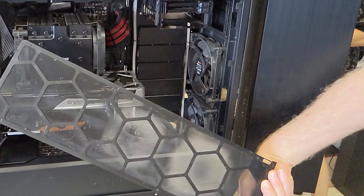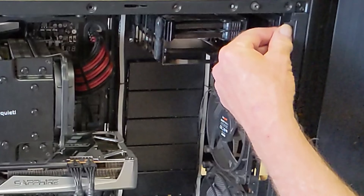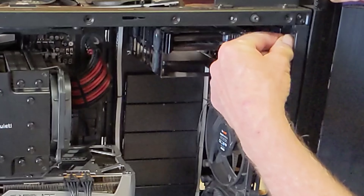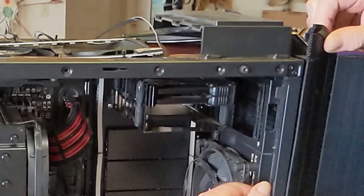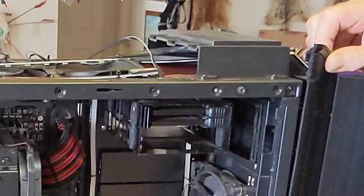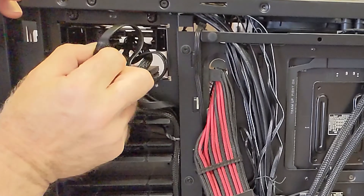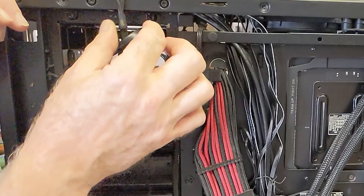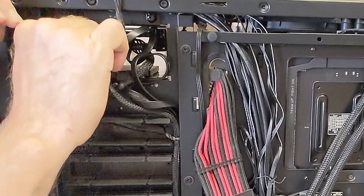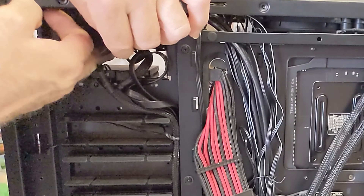You can see the fan toward the back is smaller than the one toward the front. After removing the front panel — pressing tabs from top to bottom, one side then the other — the first job is to remove the existing hard drive, disconnecting a SATA power cable from each one. I'll be reducing down to one power connection for four drives. I have five SATA data cables all nicely bundled in a cable run.